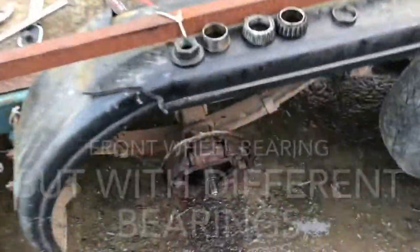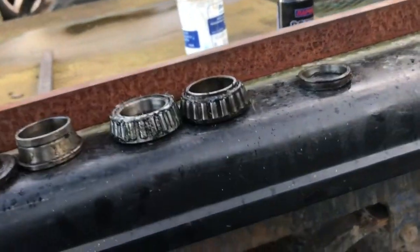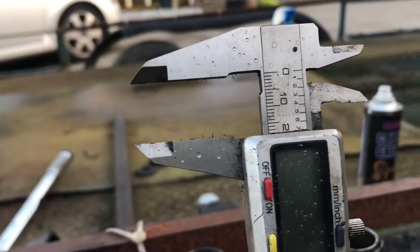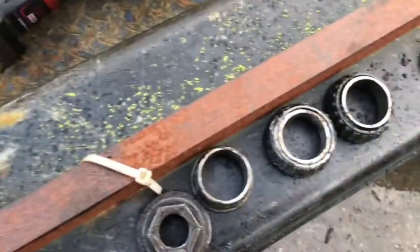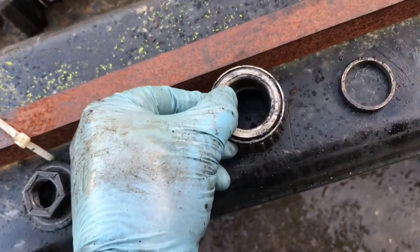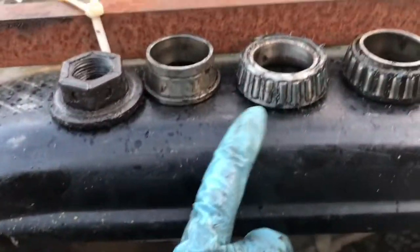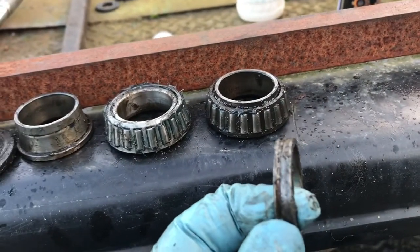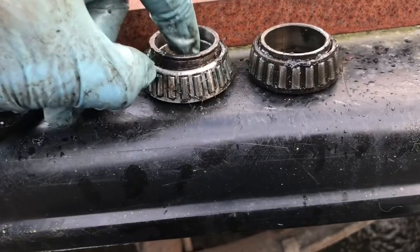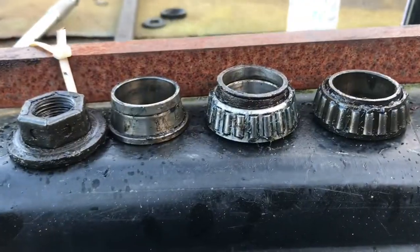An interesting little tip: if you're putting on a wheel bearing and the bearing gets jammed up as you tighten it, this may be the cause. The new wheel bearing measures 18mm across the top, the original measures 15mm. With two wheel bearings inside the hub, when they're tightened up their flanges have to kiss each other. My wheel bearing kept jamming and I couldn't figure out why — the difference is 6mm total (3mm plus 3mm). So here's a little 6mm spacer made from an old wheel bearing cut up on the lathe. Add that spacer, put the second wheel bearing in, tighten it up, and it all works. That only took me two hours to figure out.